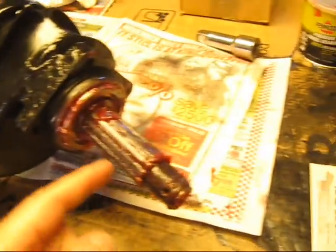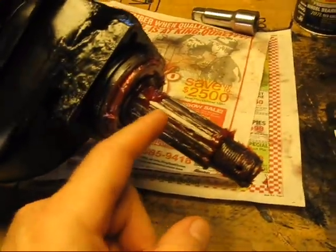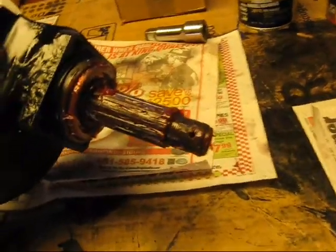You never want these splines to get beat up in the process, and they can get beat up. The bearings certainly can. All the threads in here are tapped out, chased out, cleaned, and deburred everywhere you look, making sure there's nothing there that's going to cause a problem. So here we have it.